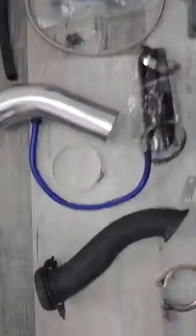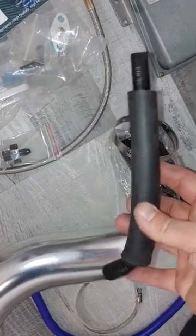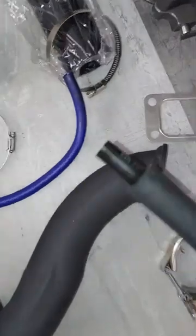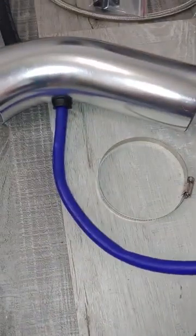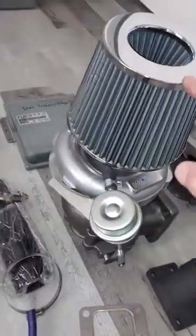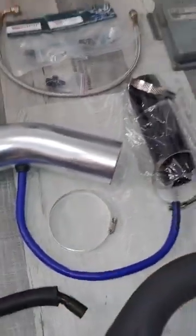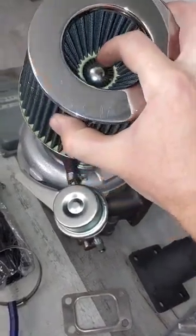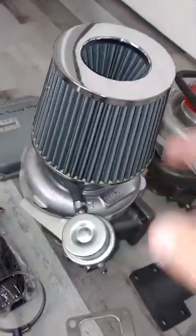This has a hose — this is what comes off the valve cover. This is a vent tube. This end goes inside of the cylinder valve cover and this end plugs in here to give you a nice extension, or you can just vent to atmosphere. You could also drill a hole here and put a barb or nipple there and have this hose going straight into there if you wanted that option.